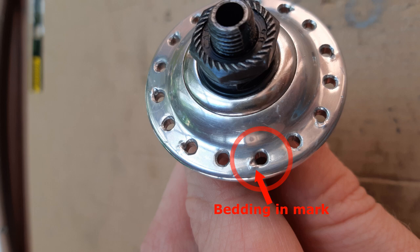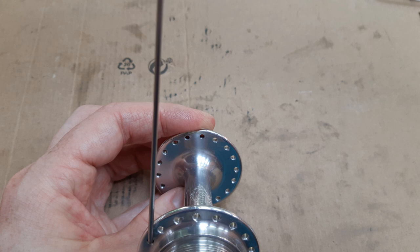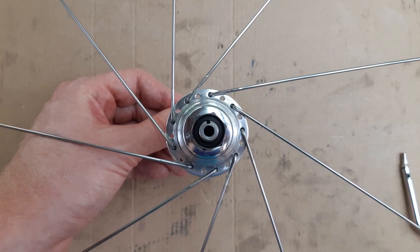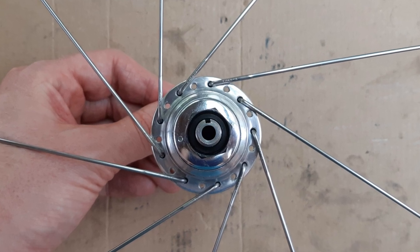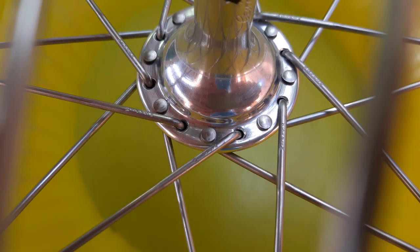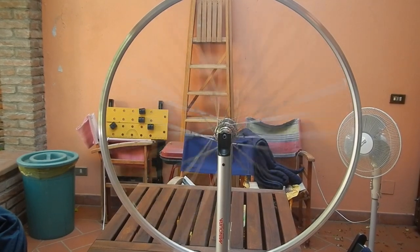Those are the marks I've highlighted here. These are created by the J-bend of the spokes as they exit the hole. On both the front and rear hub, the first set or leading spokes on each flange were laced heads-in, meaning that the spoke was inserted from the inside face of the flange. I've repeated that lacing style for this build, and as you can see, the new spokes cover the old bedding-in marks perfectly. If I had gone heads-out or started at an adjacent spoke hole swapping leading to trailing, those marks would be visible and a bit unsightly as a result. Both wheels were a dream to build, and as an amateur wheel builder I was very happy to get the spoke lengths perfect.